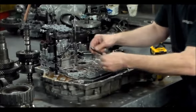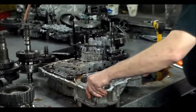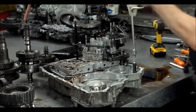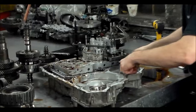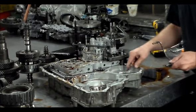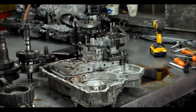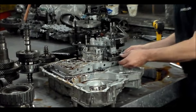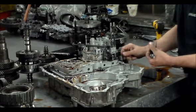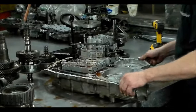Alright, these tubes here. Take these out. And then there is a sleeve. The sleeve is good, but behind the sleeve there are O-rings, and those O-rings really need to be changed. All right, so then we're going to take the park out. Okay, that'll slide up here, and here is the rod, so we can't move too far.